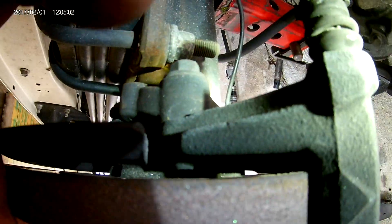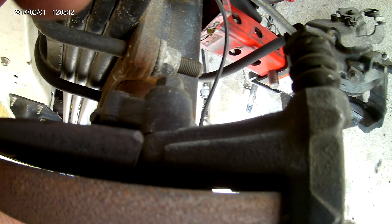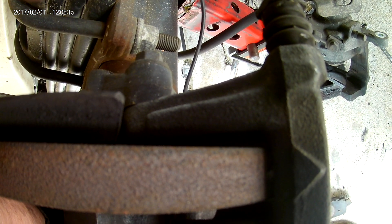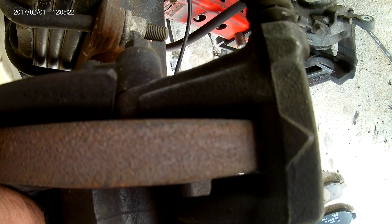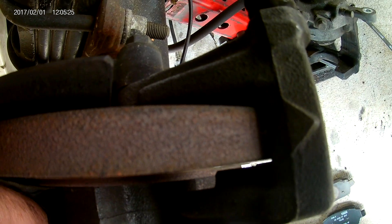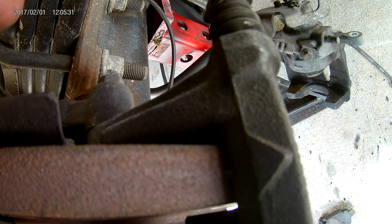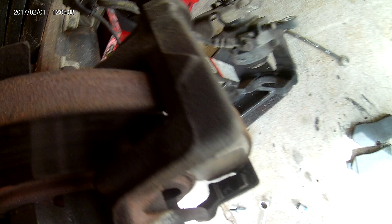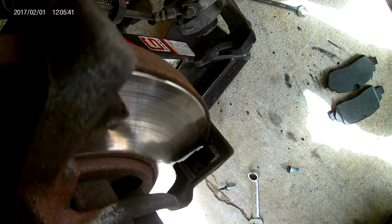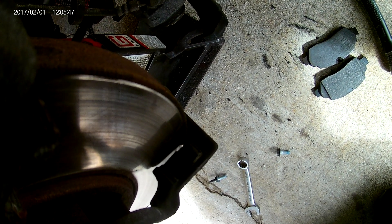On top of that, keep an eye on your rotors because they do start getting grooves cut in them. Wheel seals — I've replaced probably six or seven wheel seals on different vans already, so keep an eye out for those leaking. Brake life ranges anywhere from 22,000 to 34,000 miles — I've actually had one get into the rotors before I got to it. These pads are not much bigger than what you'd run on a four-door SUV, which is kind of surprising. That's why I'm calling this the engineering disaster — be prepared to do rear brakes on these vans.